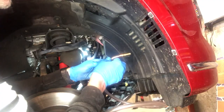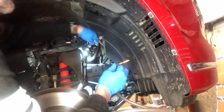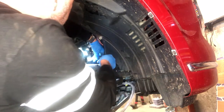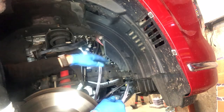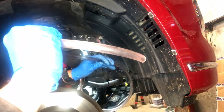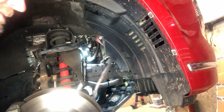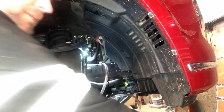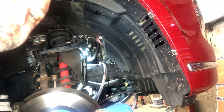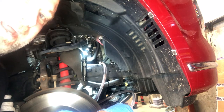The clear vinyl hose with a 3/8 inch internal diameter and a brass barbed fitting. We're going to fish this hose out that we just popped off and insert it into the transmission hose, and then we'll run the other end of this into a measured receptacle so we can see exactly how many quarts come out. As a note, you don't want to take out more than 2 quarts at a time, or the pump will run dry and likely cause you trouble down the road, as it were.